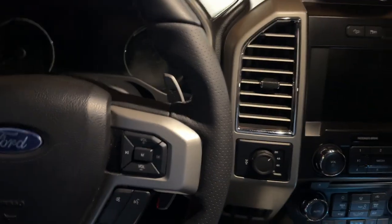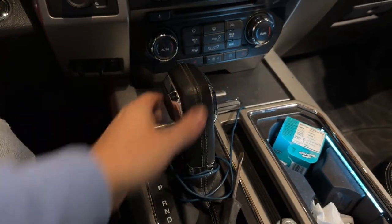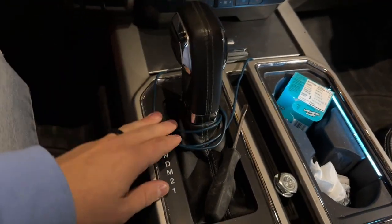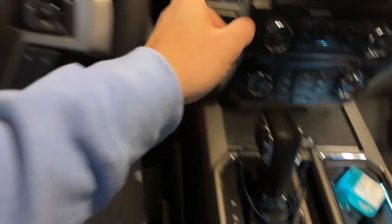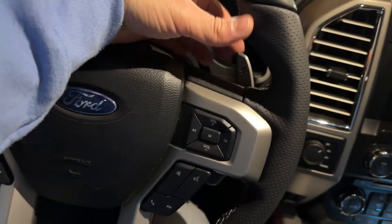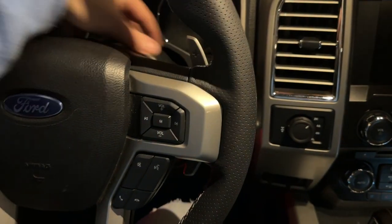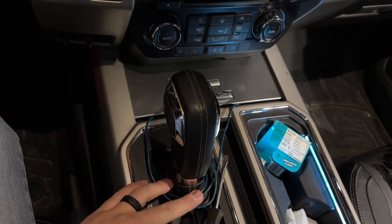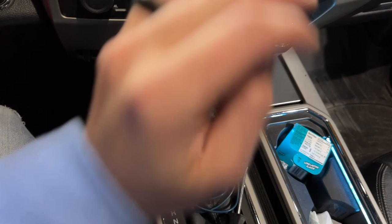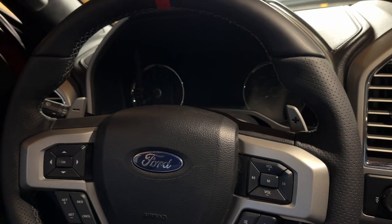I'm not sure if you guys know what the process is, but their instructions are pretty detailed. Pretty much what they say is you have to take this piece off here, take this piece off, take off all your center console. Because I have the center console shifter, there's a little wire in there that I have to disconnect, reconnect it with their harness, and then run it under here, up here, and then into the steering wheel itself — and that'll actually make these paddle shifters work. If you've seen videos where they have a column shifter, that is a lot easier. Unfortunately I picked this route and it's going to take a little bit more time than normal to get the wiring done, but I will be posting a video once it gets a little warmer. Make sure you click the subscribe button and stay tuned for that.